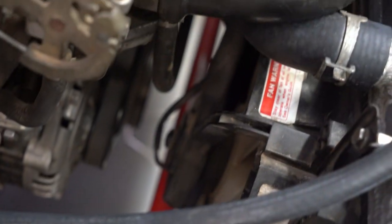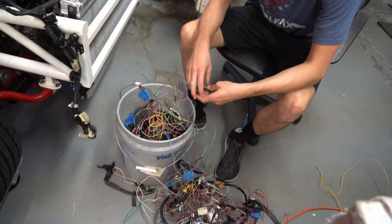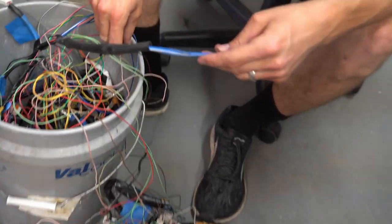This is the radiator fan connector and we never found any wiring — even on the new wiring harness — that would connect this to anything. So we're just gonna hardwire it to a switch and put the switch where we need to. We didn't think to check until just now but the fan that is already installed and blocked by lots of things doesn't actually work. Oops!